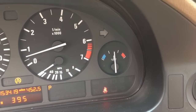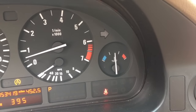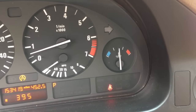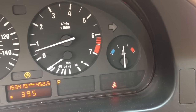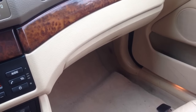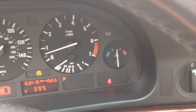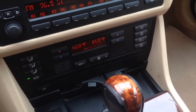This is pretty much perfect temperature right there — anything over that and things are going wrong. The problem with this fan isn't that it doesn't work, it doesn't work consistently. So we unplugged it, we sprayed out the plug that goes into the fan up under the hood — it looked good. We WD-40'd it and plugged it back in in case there was a connection problem. We did check the fuses behind the glove box and both of them were good. I'm not sure if there's a problem with the fan itself — it looks like it's spinning full speed whenever it comes on. I could turn the AC on and it'll come on, but not every time.